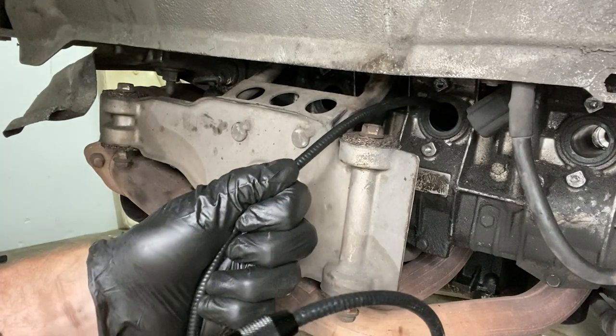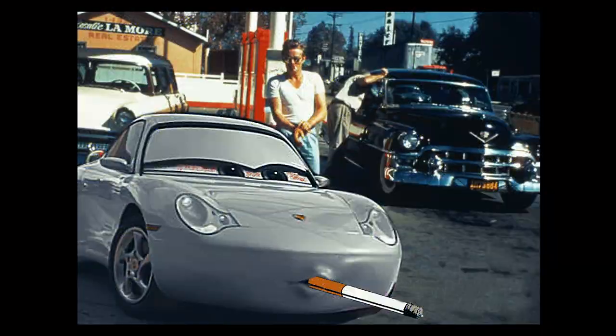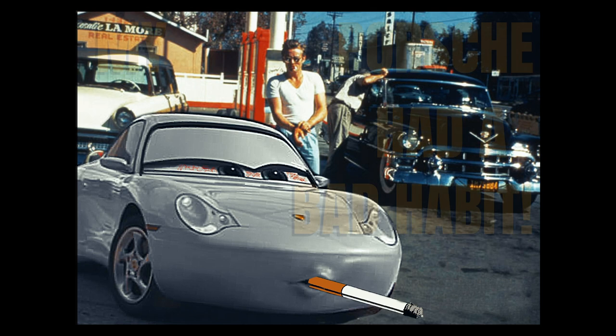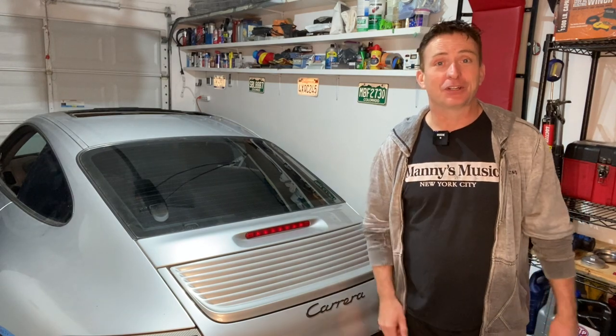So what nightmare did I witness inside the cylinder? This is the image I saw on the fuzzy borescope screen, which my brain immediately processed as a nightmare where the pistons have hit the valves and grenaded the engine. The best I'm hoping for is that this car has been smoking heavily since birth and the piston surface just has some crusty carbon buildup. The next plan is to shoot video of the inside of each cylinder while turning the engine slowly by hand, which will hopefully tell us more about the engine's health.